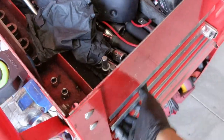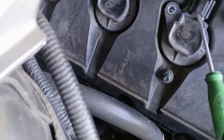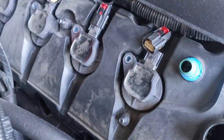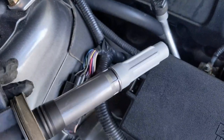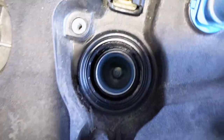Maybe a pocket screwdriver is what I need. Do as I say, not as I do - sometimes you can push the little clip up and this will come off, sometimes not. Alright, maybe this is just a two-handed job. I'm going to put the camera down and unplug these. Take all the little connectors off - that was pretty easy once you have two hands. Then with the little coil packs, you just pull on them and they come right out. When you pull these out, you want to inspect them - look around the outside and make sure there's no cracks, and look down inside to make sure there's no oil in there.